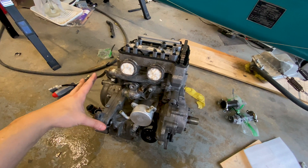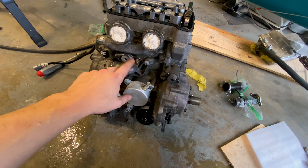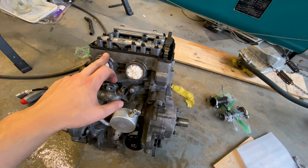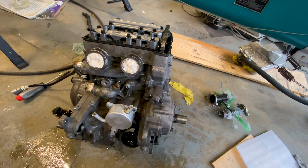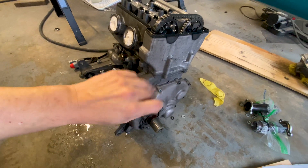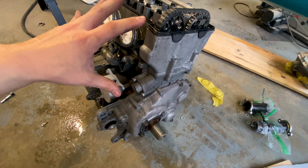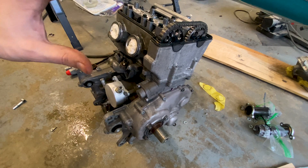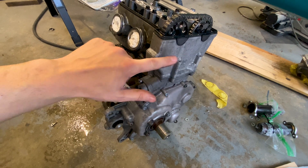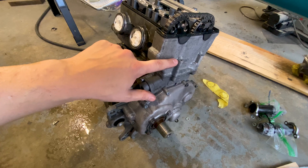So now we've got the engine all torn down and cleaned. Honestly, it's possible I should have taken these hoses off before I cleaned it because there's some corrosion under here I may have to take care of with a wire brush. But that's okay. I just want to show how good the engine looks now - we've already got a huge improvement. This is verging on, if this was going in a cowled airplane, I'd probably just leave it at this state. It's clean aluminum, it's fine. But aluminum that's been this cleaned is going to oxidize again, so I am going to paint it. That's going to make it shinier, look prettier on the airplane, and protect it since it's going to be out in the elements.